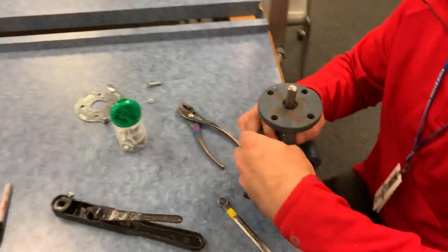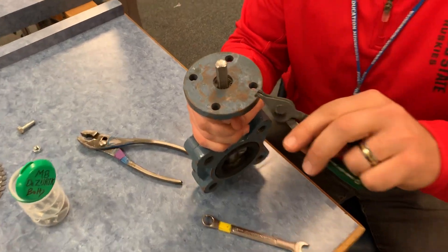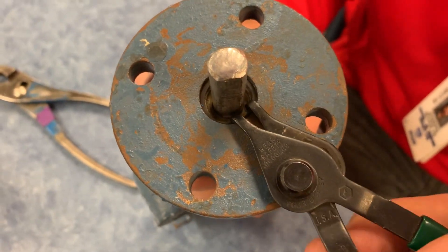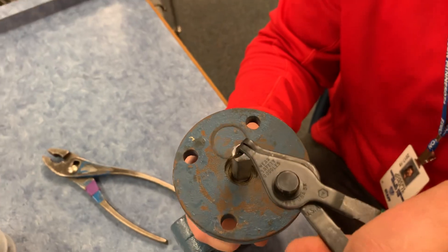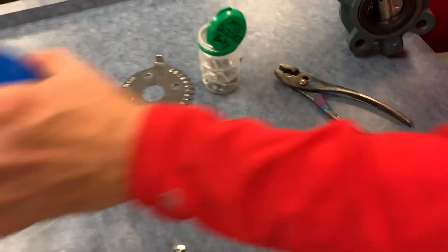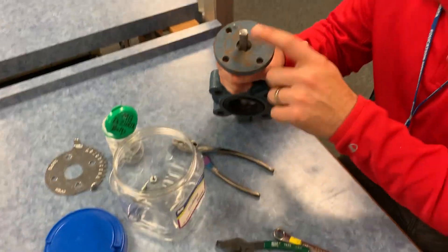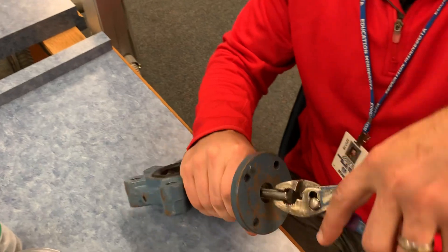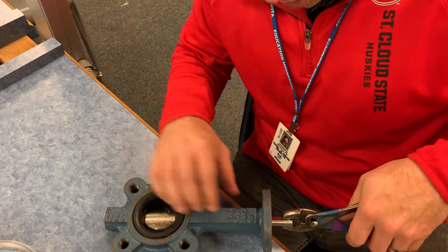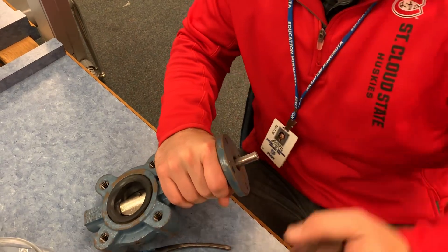So how do you use snap ring pliers? It's a double-acting pliers — it can squeeze together and draw these two holes together. We line up on the two holes, insert there, then squeeze this together and it compresses the ring. Like a game of Operation, we bring this out — try not to let it go flying. We put that component into our container bin along with our bolts. Once that snap ring is out, we can take pliers and twist, but it's not going to come out yet because we've got one more step. We've got to get our roll pin aligned vertically, and you may want to use the handle to do that.